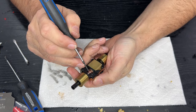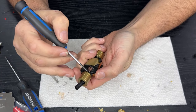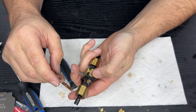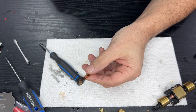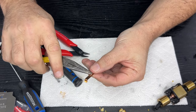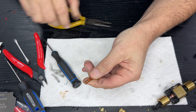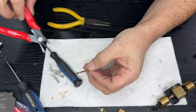When you remove this, remember that underneath this strip is a spring and your brush for the commutator, so keep your finger above that clip. Remove it - it kind of hooks in at this side, so hook it in there first then clip down. I think I'm going to snip this - maybe bend it up first because we really don't want this poking down onto the frame. Snip that nice and neat, same on the other side. Make sure they're not poking up.